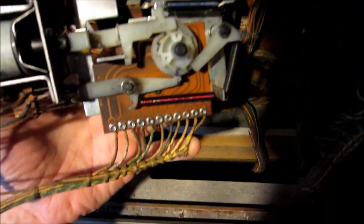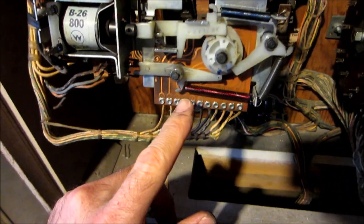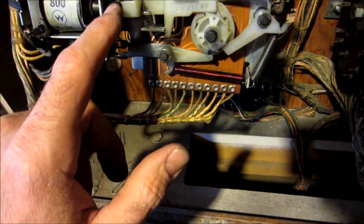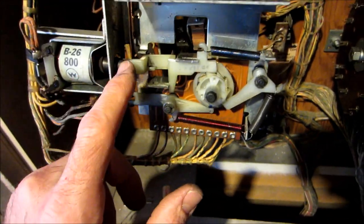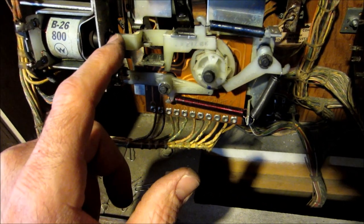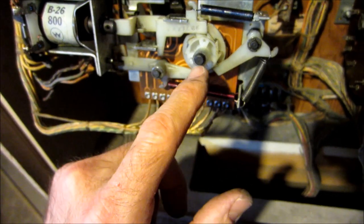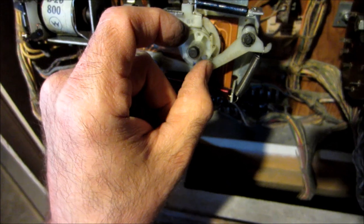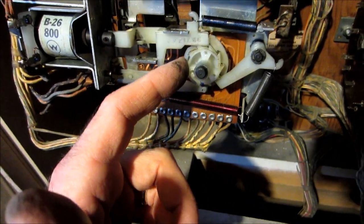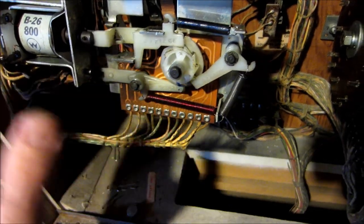All I did was really take this apart and clean it with alcohol. Taking it apart is pretty straightforward - you take off this spring, and then this arm connects to the coil. So you take the spring off, this plastic arm connects to the coil and then it just slips out. You can move this arm out of the way and then this mechanism - or this spool I guess you'd call it - comes off. Clean it all up with alcohol and put it back together.